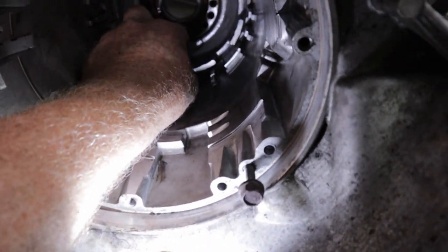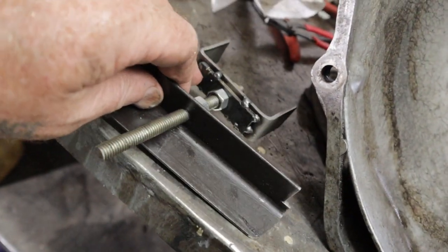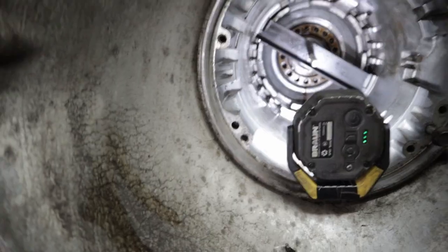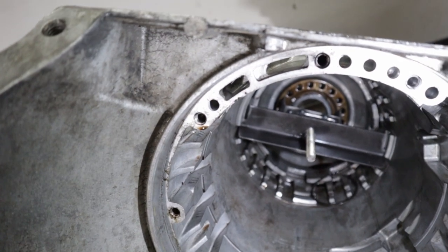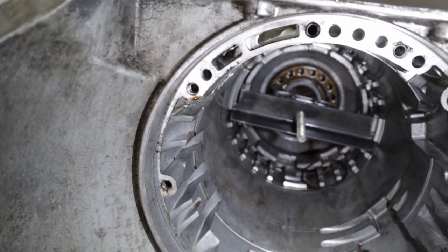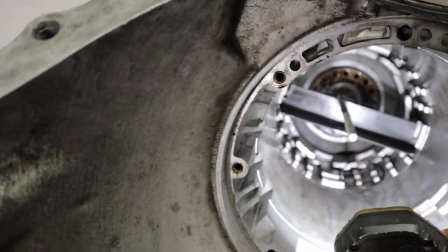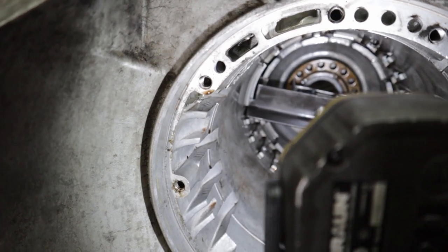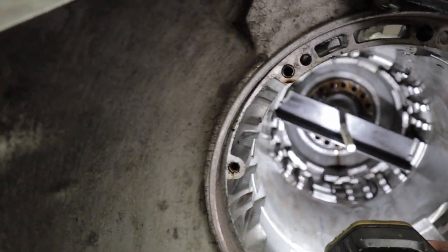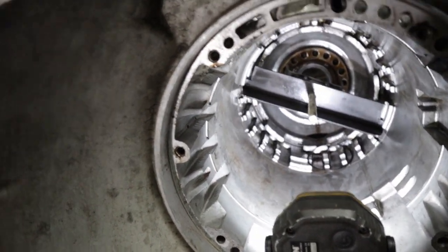And to get this snap ring off around there, get a contraption like this, that these ears here actually hook on the inside of the case. You see that clamp in there, that ring with the little holes in it, there's a spring around each one of those holes and it's trapped inside there. You take that spring off, you're not careful, that gold ring with the holes in it will get stuck. It'll get caught in where the snap ring came out of, and you pull the bracket off, and everything goes flying.